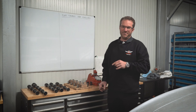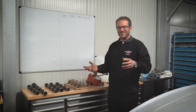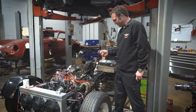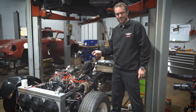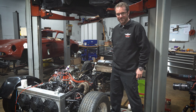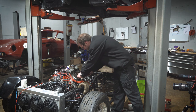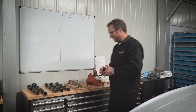Also check your valve lift before and after that bedding-in process. Get a dial indicator gauge, put it on top of one of the valve spring retainers, and check the actual lift on all of your valves. Do the same after bedding in, to make sure none of your lobes have been knocked off. Another important thing about bedding-in: if you're using uprated valve springs like duplex springs or stiff single springs, put a weak spring in, or take out the inner spring of a duplex spring during the bedding procedure. That prevents excessive load on the cam during that critical bedding-in process. Once it's bedded in after the half hour, use a special tool to compress the spring in situ at TDC and replace the valve spring with the high uprated ones.